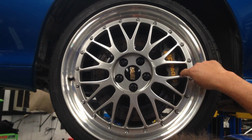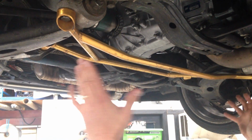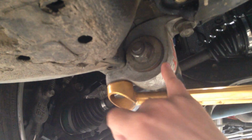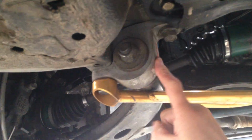And you can see the clearance inside the AP Racing caliper, just how tight a fit it is. What else? It's got the Whiteline lower chassis brace to stiffen the pickups of the lower front suspension from a geometry and a stiffness point of view. It's got one of the very early designed Whiteline anti-lift kits, which in those days were not anodized. They were still original raw aluminium. They're not cast, they're still fully machined, but a different design look, but obviously very, very original.